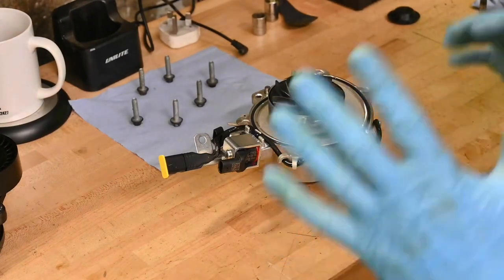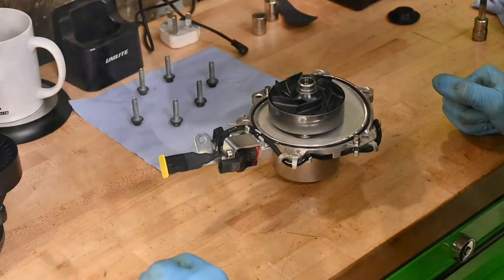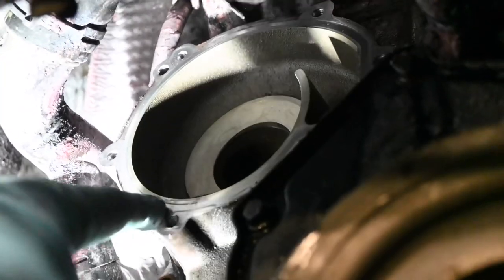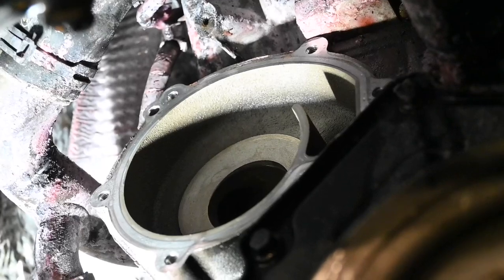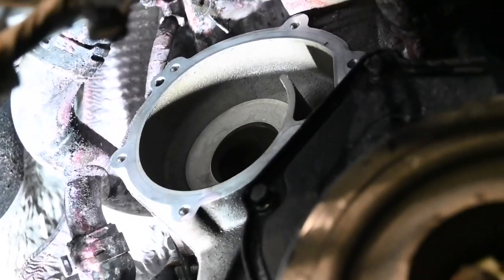All we need to do now is fit the new water pump to the engine. But before we do, we have to clean the mating face on the engine side to make sure we ensure a solid seal and have no more leaks. Back at the car — this is where the water pump will bolt back to the engine. We need to make sure the mating surface going all the way around is as clean as can be. Any dirt or debris may compromise the seal. All you need is some high-grade emery paper or wet-and-dry to take off any bits of dirt, debris, or dried coolant.